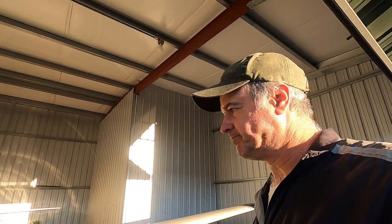It is a 1964 Mooney M20E. It's the very first year of the E models. It has the stock IO-360-A1A engine, which is the same engine used on Piper Arrows and a lot of other 200 horsepower airplanes. It is different than the engine in the 201 model. The 201 model has a different valve geometry, so they redid a special engine just for that airplane. So this airplane is a little bit different than stock.